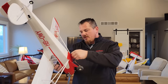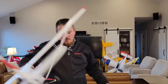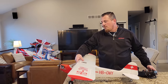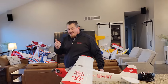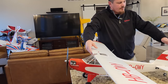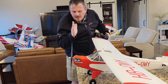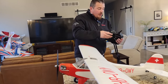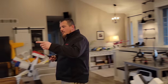Real quick check: that glue will eventually hold right there — not yet but it will. I'm going to throttle up to check the vibration. Still got a bit of a gasser going. I'm watching the prop tip slowly — I can see a little bit of forward and backward movement. A lot of times you can actually straighten that, but I think what's going on is we just have a little bit of extra material on the end. Throttle cut is on and tested.